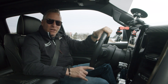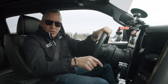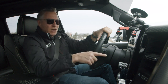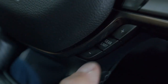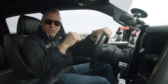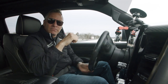We've got the 2019 Ram off the hoist and out on the highway — we're about to take it for a rip. This is the muffler bypass setup. Before we do that though, I want to give you a quick heads up on how to get rid of the multi-displacement cylinder activation on your 2019 Ram. With the truck running and in drive, hit the minus button, then toggle up with the plus button until you see the number eight appear in the dash. I want to hear the V8 sound — I don't want to hear my cylinders cutting out. Let's get it out on the road and give it a listen.